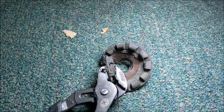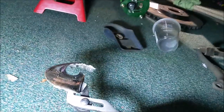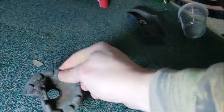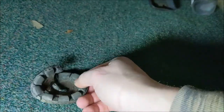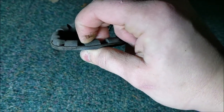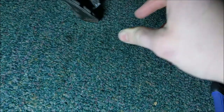The stock setup uses this little spacer thing — this one's all mangled and cut up. It would sit flat up against the car. It's pretty thick, and these are not hard but squishy — I can squish it with my hand. You can see how much I can move that just with my finger. When you tighten it down it can only move so much, but that makes it that much taller, that much more spacer between the body of the car and the subframe.